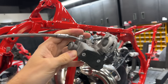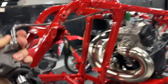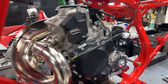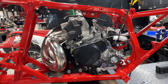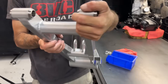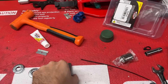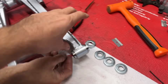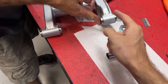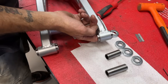We've got the hydraulic clutch, which is going to feel really nice — very excited about that. I've had tape wrapped around the engine for about six months because we've been taking this engine in and out 40 to 50 times getting everything where we want it. A simple way to press bearings in if you can't get them is to just use a vise with a rag. One thing I really like about the 250R pivots is the nice bushings on each end. We ran a custom smaller bearing on one side, which is a very similar size to the dirt bike ones.